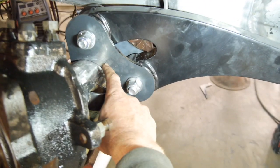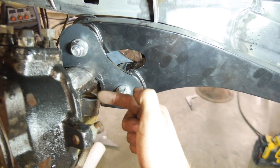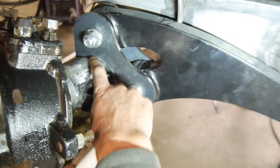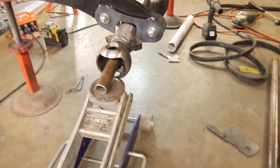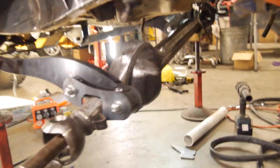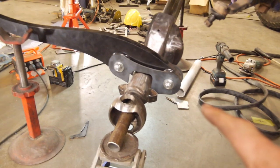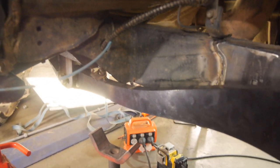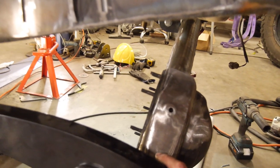I've done a little bit of scalloping on this bracket — I needed a little bit more. Currently this side of the diff is sitting about 10mm further forward than the other side, so I just need to radius that back a little. I threw it in the mill before and milled a bit of a radius, but I need to go a bit more. Over on the driver's side you can see that flex — it's getting me pretty excited. But I really need to get the radius arms at least tacked on so it's actually going to simulate what it's going to do. When this comes up it's kind of limited by the shock tower. I've also cut them off — I've got the plasma and put a nice radius on one, and the other one is more just a straight cut.